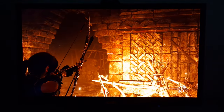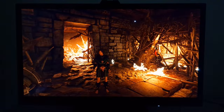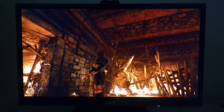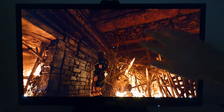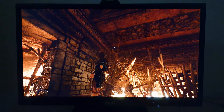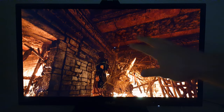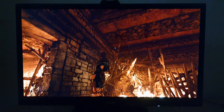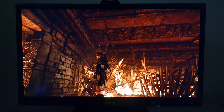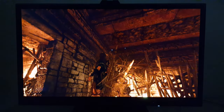So even for these little embers here, the darker background, no unintended haloing or anything like that, perfect precision. So it really does deliver the kind of atmosphere that you'd hope for scenes like this. And I don't know if this is intended, but there are actually tiny little patches of light. I don't know if you can see that, surrounded by very, very dark shades up there. Even those little patches of light on mini LED solutions, even if they've got, let's say, 1,000 dimming zones or a little bit above that, you would still see a distinct halo around it because this monitor essentially has over 8 million dimming zones. There's a huge difference there. It does make a difference. And I'm not saying that you're always going to notice haloing, and it's not something that's always going to bother people on these LCD monitors, but it is definitely worth pointing out the precision here.